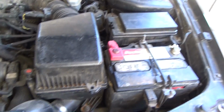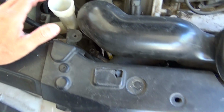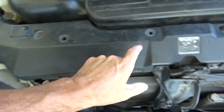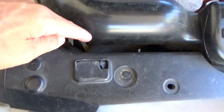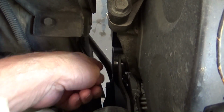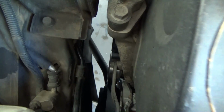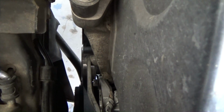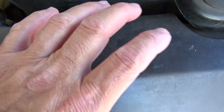So I'm going to have to disconnect the battery, take this out before I even take the wheel off. I'm going to see if I can, because from the videos you have to take all this stuff off, and I'm going to take this stuff off and see if I have access to the alternator, which is right there, before I even pull the wheel off, because here's a pulley right here that you have to take that nut off, and then underneath there's an adjustment screw that goes up. Hopefully the 2005 is the same as the 2004. Mine's a 2004. And the 2006, when he was taking the alternator, he didn't show you how to do any of that. He was just showing the removal of this.